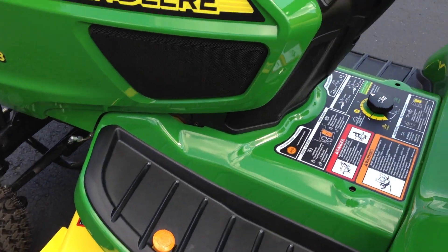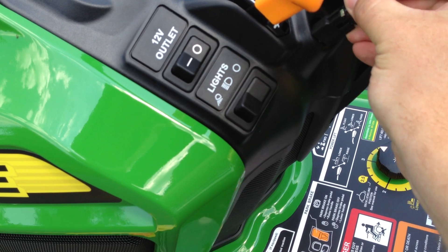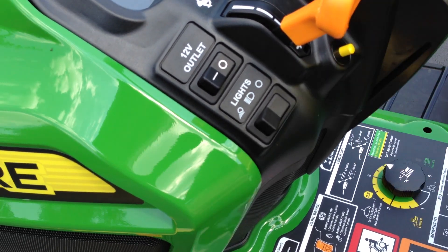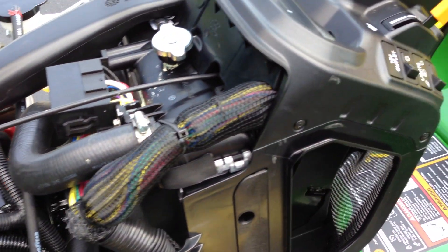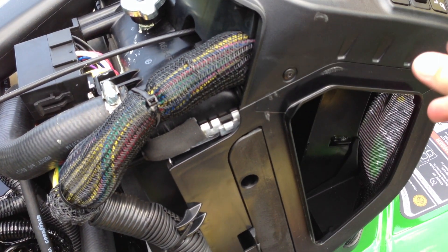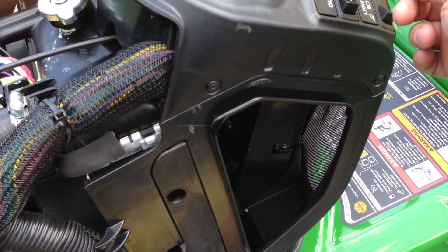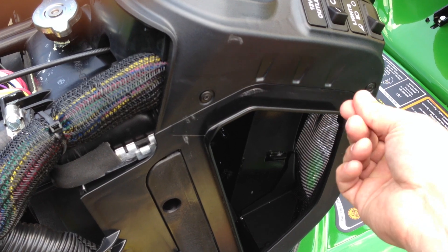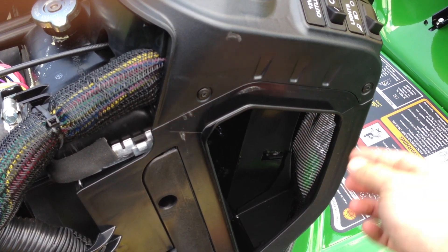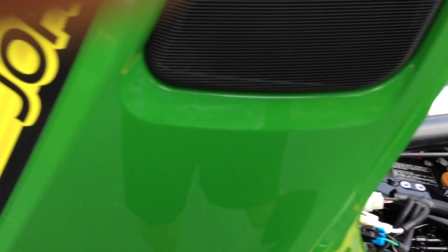And then for the RIO, you can see you have the button up here. If you pull this out, you have a green and a blue wire. I was going to take this all apart to get at it, but what I found was really easy — I took these two screws out and the other two out too. You can open this up just a little bit and the two wires easiest to see were those green and blue wires. I took another scotch lock connector and crimped those two together, which makes it think the button is depressed, so you don't ever have to hit the button again to go in reverse.